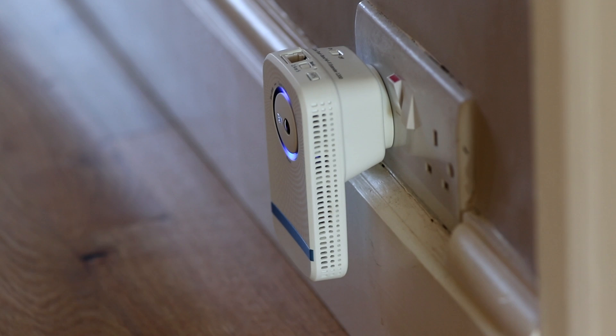This works in a number of ways. The first and most common way is your classic Wi-Fi extender that connects to your existing Wi-Fi router via Wi-Fi and then creates its own signal for you to connect to. So if you're downstairs and you want to connect to the downstairs extension, you connect to it, which in turn connects to your router.